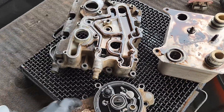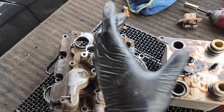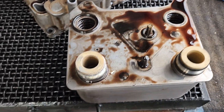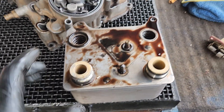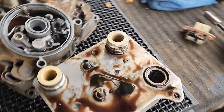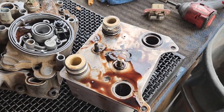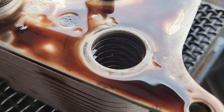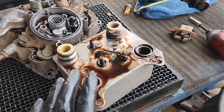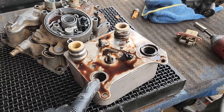When you're looking at it on the front of the engine, it looks kind of like that when you're looking down, and then the oil filter goes right there. This unit right here is the actual oil cooler. Basically what this unit does is it flows coolant — coolant flows from front to back and then oil flows from back to front. What you can kind of see inside of here is there's a bunch of really narrow passages. It's basically like a radiator for the oil, so it uses the cooler engine coolant to cool off the hotter engine oil.